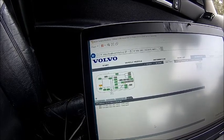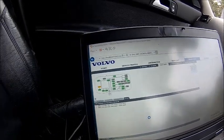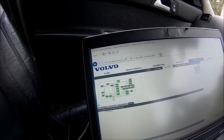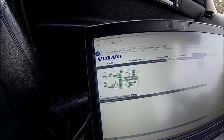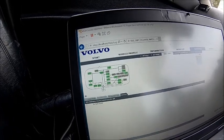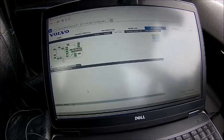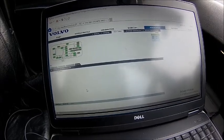It fires up quite a bit better actually. Let's clear those. Looking good so far. I have no check engine light. My fault sign is gone. We need to do the drive cycle. Everything is green. Let's do a shopping run, come back, get it warm, give it a good spin, and then we'll see.